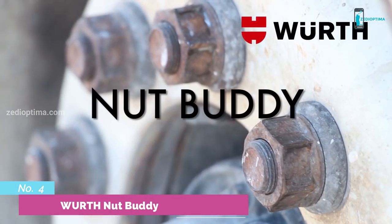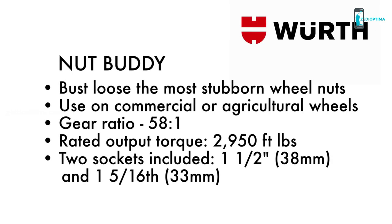Introducing the Worth Nut Buddy. The Worth Nut Buddy is used to bust loose the most stubborn wheel nuts. It can be used on commercial or agricultural wheels. It has a gear ratio of 58:1 with a rated output torque of 2,950 foot-pounds. It comes with two sockets included, a 1.5-inch 38mm and a 1 5/16 inch 33mm 1-inch drive socket.